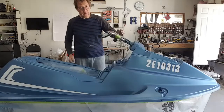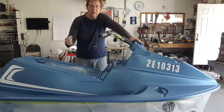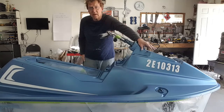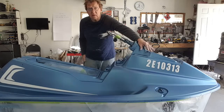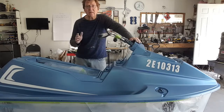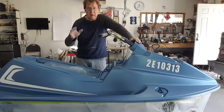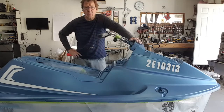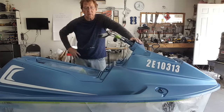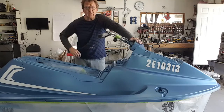Here it is in the base. I've already peeled the vinyl off the lettering and the vinyl off the stickers. What you see now is the white I sprayed prior to spraying the blue. I sprayed the white — and again, this is an Oxford white. As you can see, it's not a sharp white, and I didn't want a sharp white. I think that would be too much of a contrast. I think this white is muted enough that it looks really good against the blue, and the blue itself looks fantastic. You won't know the true color until the clear is on, but once the clear is on it'll really show itself. I think it's a wonderful blue. We've got the white ready, we've got the blue ready — all we need to do is put the clear coat on. My gun came in that allows me to go up to a 2.5, so that should be good enough for my gel coat. I'll be able to spray the gel coat in the next couple of days as well. Let's let this sit and get the clear coat on, and we'll deal with the gel coat in another episode.